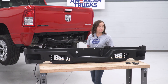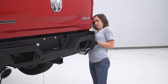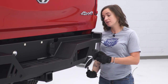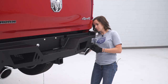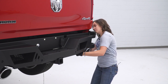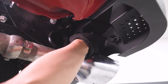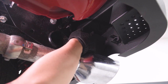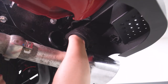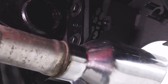Now let's grab our bumper and get it on the truck. It might be helpful to grab a friend at this point to help you get the bumper situated on your truck. There are two pegs that sort of hold it in place, but you may want to support this, especially if you're doing this by yourself. Then grab the provided flat bracket and slide it behind the bracket on your bumper. Once you have that in place, grab at least one bolt and get it threaded into the provided welded nut. Grab the smaller bracket with the welded nuts and slide it behind the bracket on your bumper until it lines up with the frame of the truck. Slide the provided bolt through the hole and thread it into the nut on the backside. Once both bolts are in, grab your 18-millimeter socket and tighten them down.